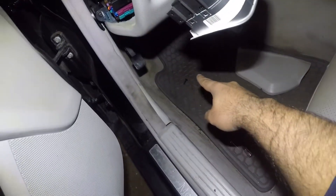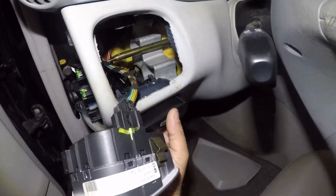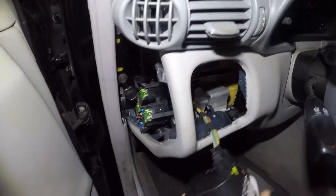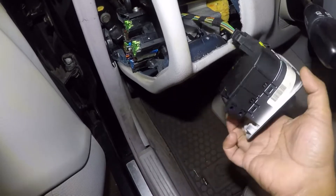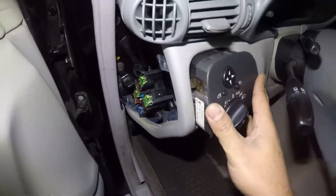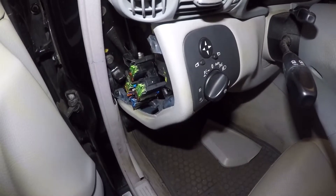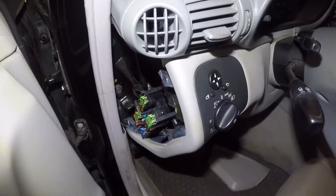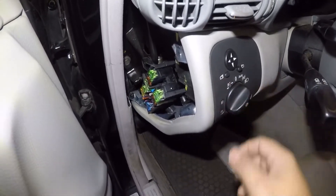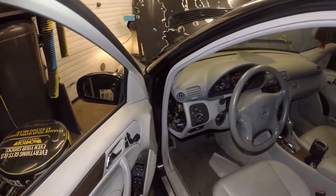This little piece has a screw going from the bottom, right there — it's the little screw all the way down. It goes from behind here; you have to pull the e-brake and get it from right there, and it's going to go into one of these holes. It should align as it goes in. Bam, that's how easy it is. All I need to do is put the screw in, put this in, and we're done.